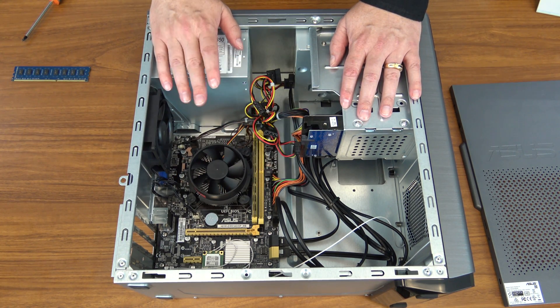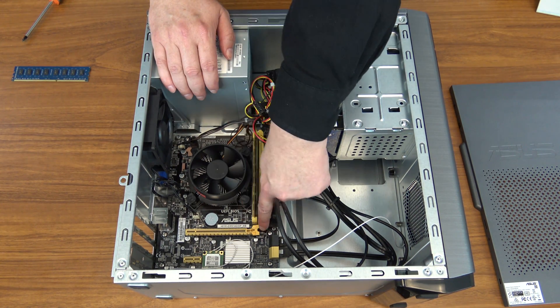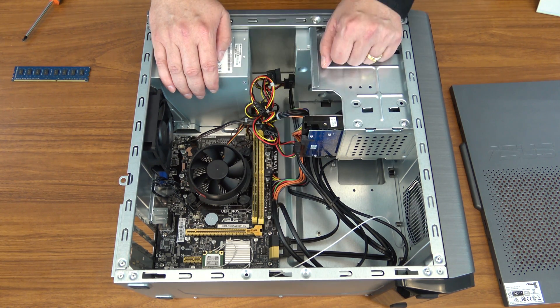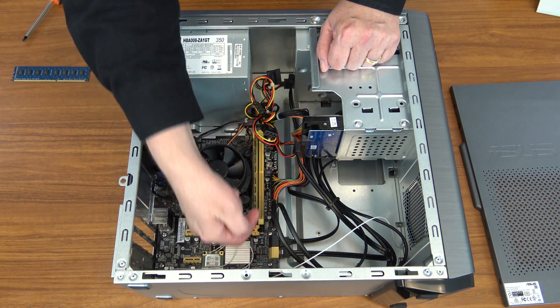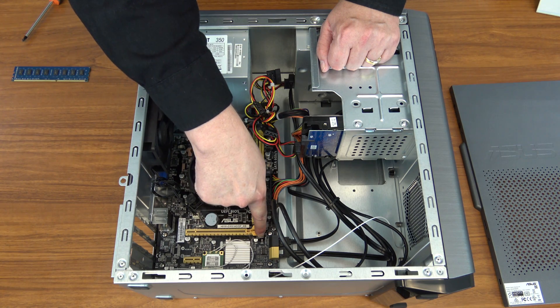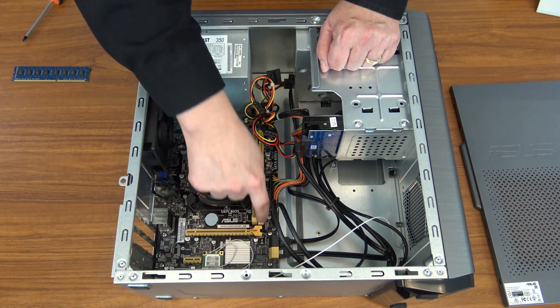This fan here is just ventilation — it simply blows heat out the back and keeps this area of the computer cool. That's basically what's inside your machine. Now to install the graphics card, there are a couple things we need to do before we actually put the card in. There is a retention tab that is currently in the up position — push it to the down position. When we insert the card, that should automatically pop up when the card is fully inserted. To remove a graphics card, you push that down to release it.